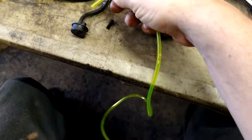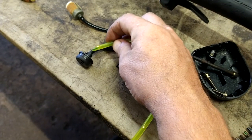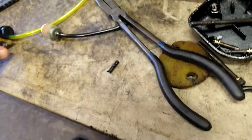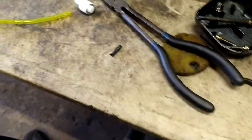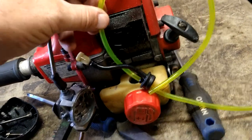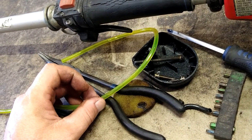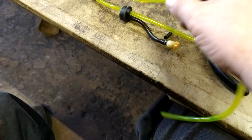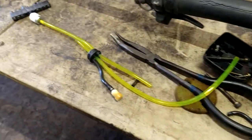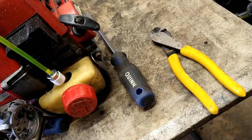The first thing we'll do is the fuel filter line. We'll cut this to a point, then we're going to stab it through the grommet, pull it through about this far, and cut the tip off. Then we're going to go ahead and stab the fuel filter on the line. We'll take a quick guess at how long the line needs to be — I'll cut it up here; it'll be too long, but I can always cut it shorter when putting the carburetor on. Cut the fuel line to a point again, stab it in the second hole, and pull it through just about an inch — that's your return line. Leave it long so you know that one does not have the fuel filter; the other one does.